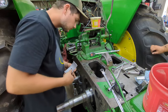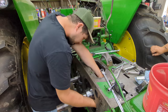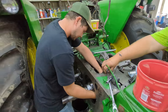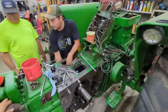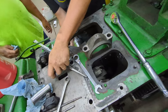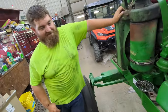So in the book, it shows that if there are no rods present in the block, you can put that center main in and go through the outer hole with the center main already on the crankshaft. But being our rods and pistons are still in our block, we had to do it the way that we did it. New bearing snapped in the rod — we'll get some white grease on that, then get our bolts and caps on. That's George's job, torquing them. He's the biggest guy in the room.